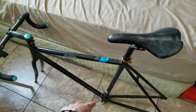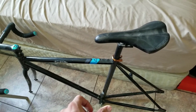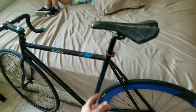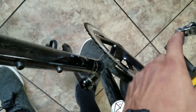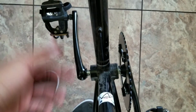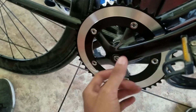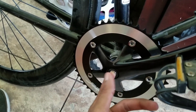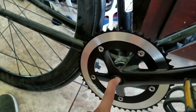I'm gonna put the crankset on, but I have to put both wheels on first to see how the chain's gonna sit. Make sure when you put in the crankset, one arm is facing one way and the other is facing the opposite way — that's the only way you'll be able to ride the bike. Put a cloth over it and then hammer it in so it won't mess up your paint, then tighten it as hard as you can — and then have someone else check it too, because if these get loose you're in trouble.